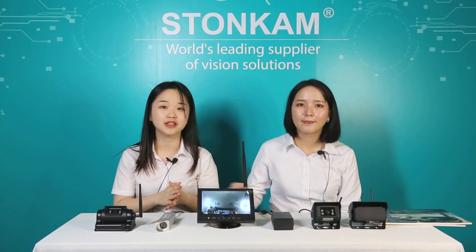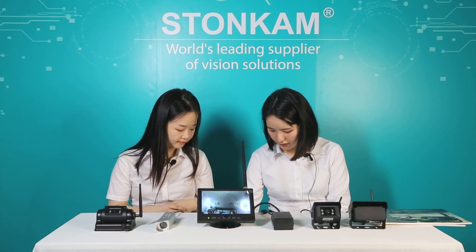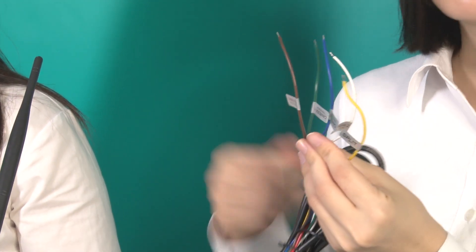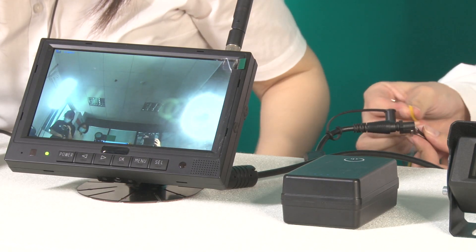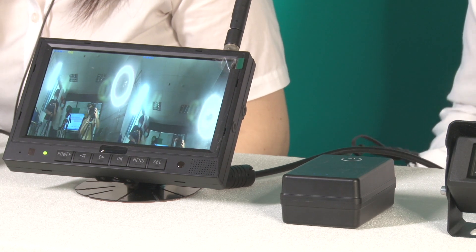After showing the main functions of the monitor, let's look at the wire connection. Except for the two power wires, we have four trigger wires for four cameras, and one trigger for a split view. When it is powered, the monitor will change to split view mode automatically, and then change back to the normal view automatically in a few seconds. We also have an extra antenna for extremely long vehicles.